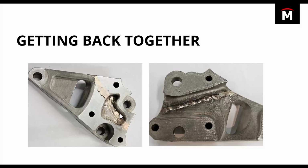On the top face of that part in the left image, you can see where it looks smoothed out. After I'd welded this together, I used 220 grit sandpaper and some hand files and basically knocked that whole face down, and it actually looks really good. It's hard to take images of a brushed metallic material, as I've found out, but it turned out really well. You can see that on the left-hand side where all of the joint filler material has been knocked down. On the right-hand side, I didn't sand or file that brazed joint, so you can see what that raw weld actually looks like.